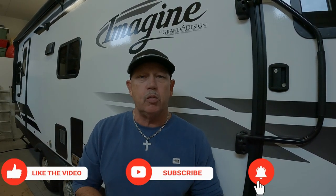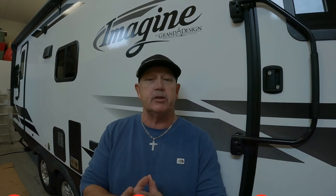Welcome back to Over the Hill Adventures and today we are going to grease pack our bearings. We have traveled over 21,000 miles. I checked it a year ago and we had just traveled 10,000 miles — at the same time I redid the suspension and put the new suspension on. So this time I am going to check the brakes, repack the bearings, grease pack the bearings, and re-grease our Moride suspension, our wet bolts if we need to.